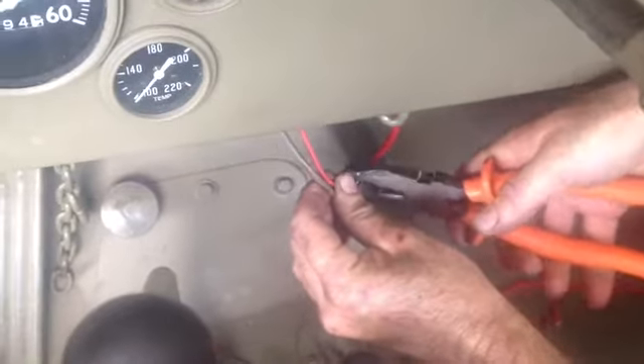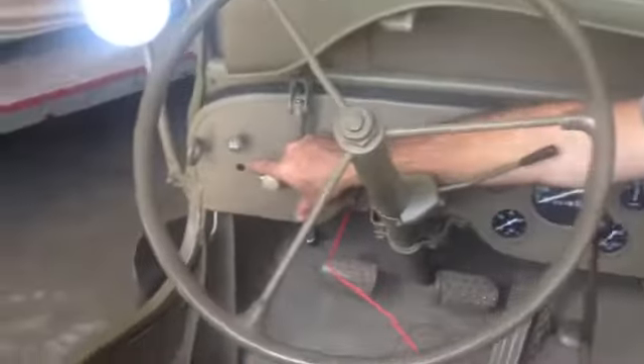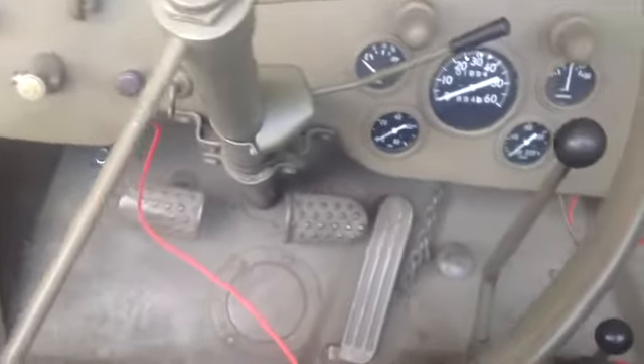So what's this doing, Dad? This is the one coming from the battery to the amp meter. I'm splicing off that — right here where our little push-button is going to be to activate the electric solenoid to start the car. So it's taking care of that, completing the circuit.